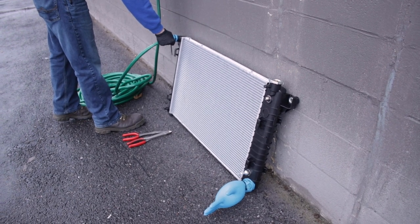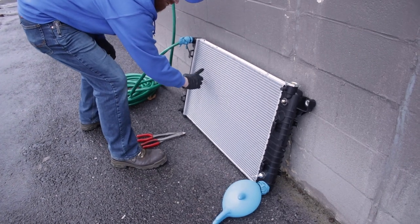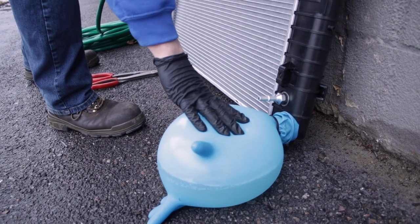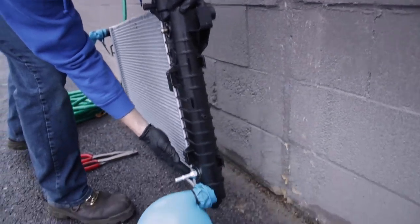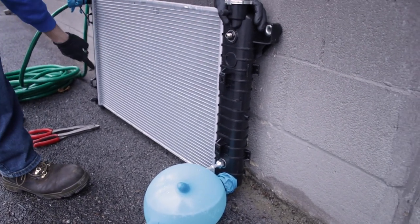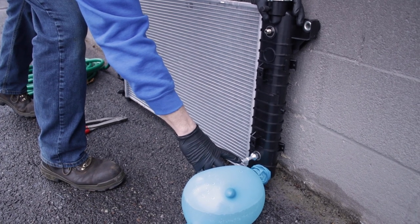All right, we're building some pressure here — this is kind of cool. Right now the water's flowing through here, coming through these channels, and going right over there. As we can see, nothing is coming out of the transmission cooler fittings. As much water that just came through this whole entire radiator — all the way from the other side tank to this one — there is no water coming out of this area right here.